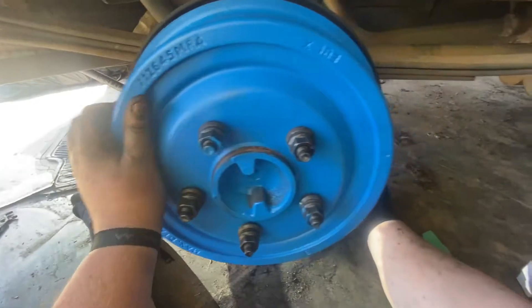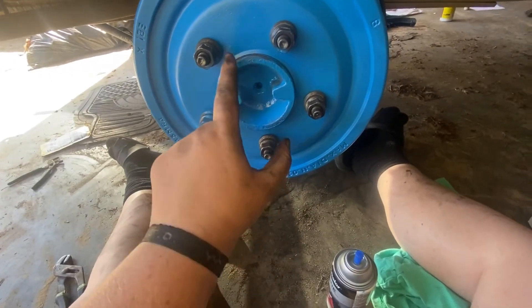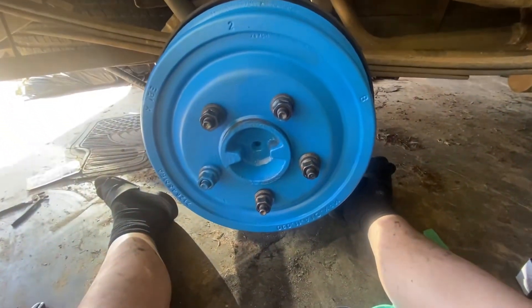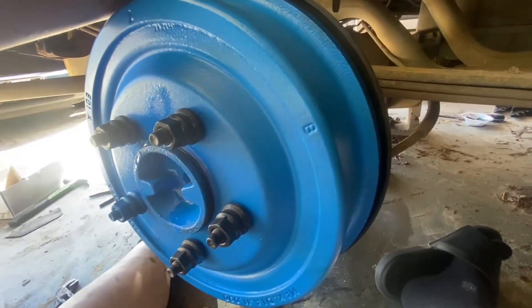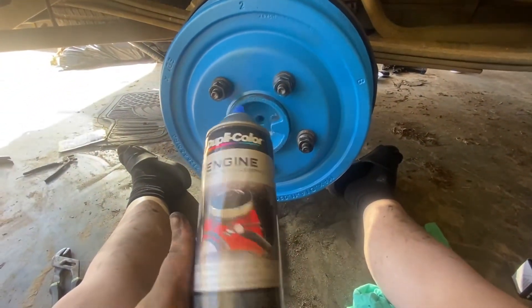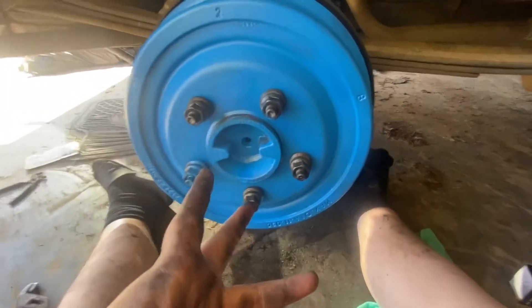We got our drums back on and now we're painting the hub itself. We're going to bleed the brakes after I get that side done — hopefully the parts come in soon, probably tomorrow. I went ahead and already replaced the wheel cylinder on this side too. We had it down this far so we said might as well just change the whole brakes so he'll actually have good brakes. We're going to get another can of this Dupli-Color engine paint — I prefer this over any kind of spray paint even for these drums. We're going to do the front calipers the same.